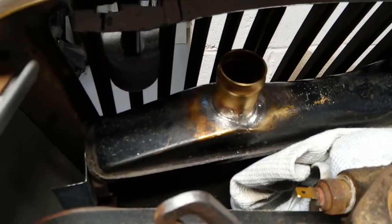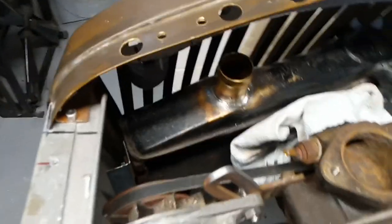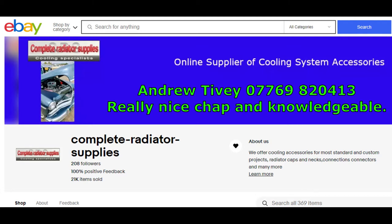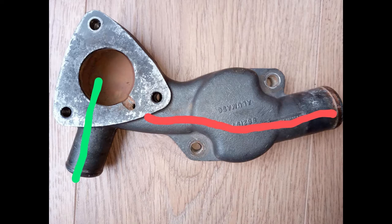There you go — to the top of the radiator. I've soldered on a brass tube where there was a filler cap. After a lot of talking to people with a lot more knowledge than me about cooling systems — Andrew Tivvy from Complete Radiator Supplies, found him on eBay — he helped me to understand this remote filler-cum-thermostat housing. It is actually two separate parts: the thermostat housing on the right and the radiator filler on the left. There's a tiny bleed hole there, which Andrew helped me understand.